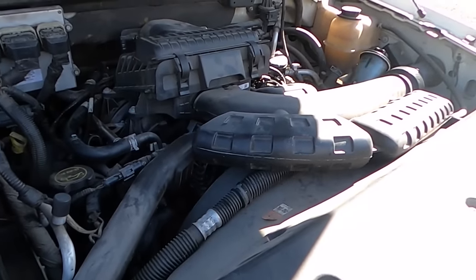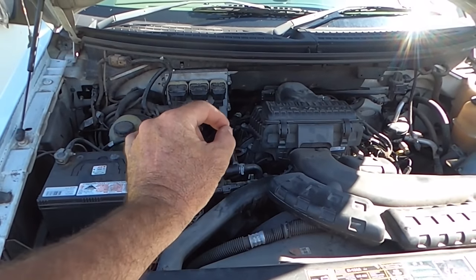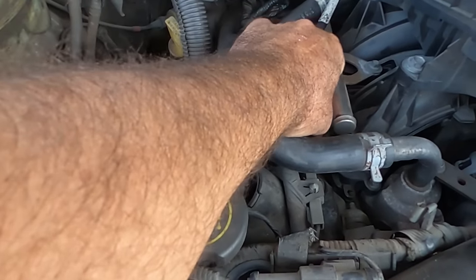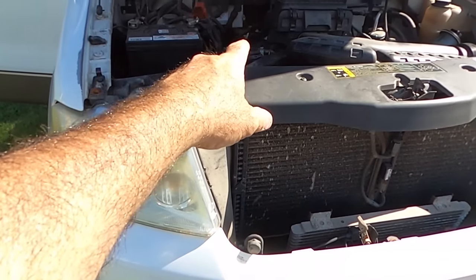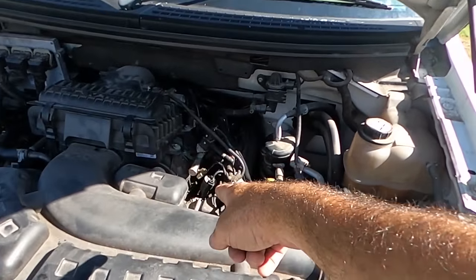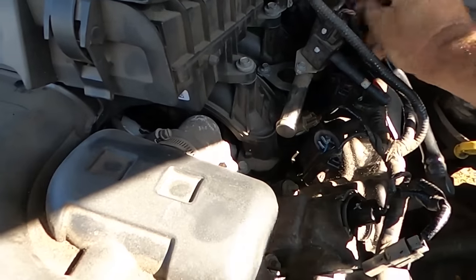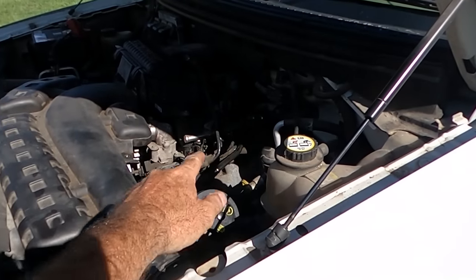It is really, really rough. And to try and figure out which cylinders we're running, I basically just unplugged the injectors. If you hear when I unplug that side, it actually dies off worse, so that injector's running. That's all I was doing. But when I went to unplug this side, none of them made any difference. Not one of them makes any difference whatsoever.